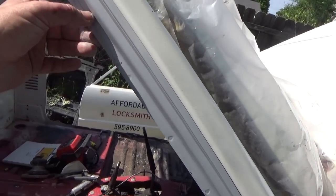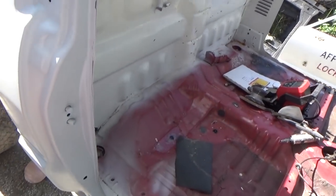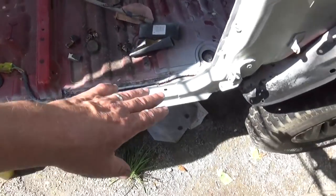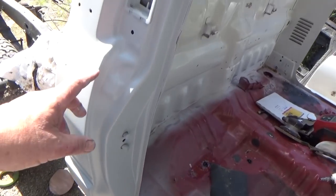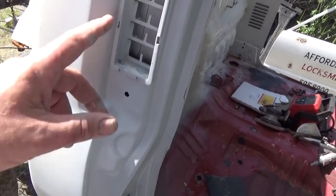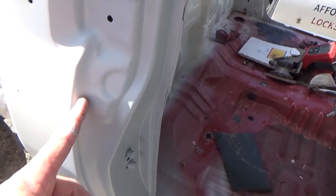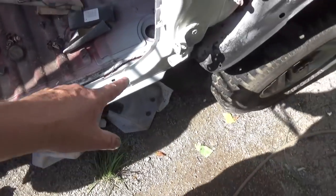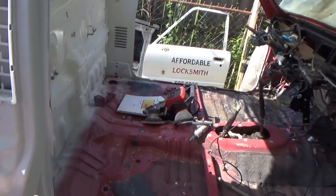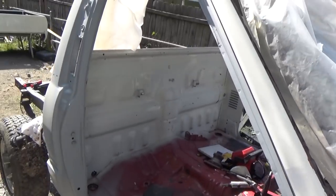All of this is shot with the heavy duty primer, I'm just waiting for it to harden up. Then we'll wet sand that and I can cut in all around the door on the outside. When I do my painting I'll cut it at this line going down on the inside of the door where the door covers it, and then on the bottom and around here — so all this portion on the inside of the door frame will be painted and it'll look good and still be glossy.